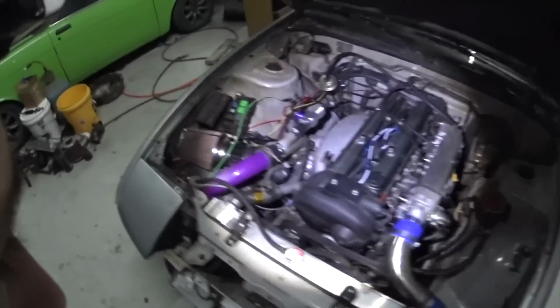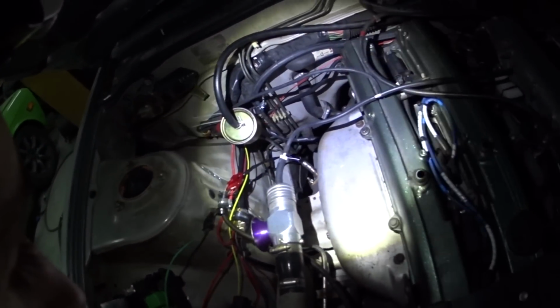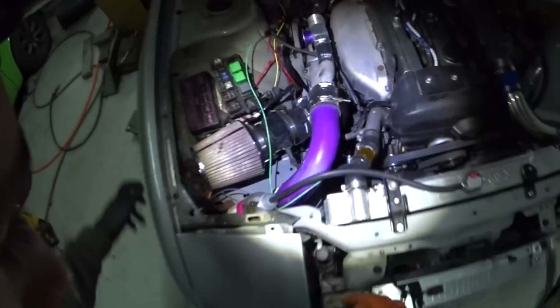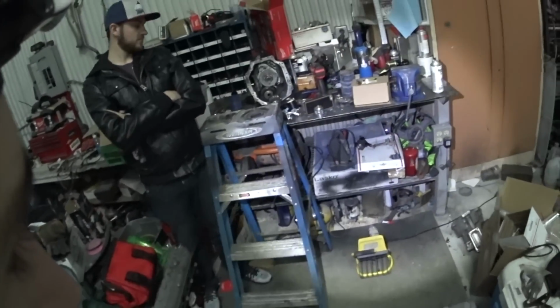And so now, right here, I had two of those things on backwards, so that wasn't wired correctly. The mass airflow sensor, I cleaned that. And now the AFRs are a lot better than they were initially. It would kind of sputter and die and do some random dumb stuff. So I've had this up on the bumper rack for a little bit. I had to use my little ladder to get up there and do that.